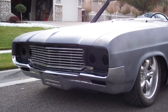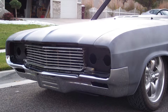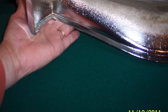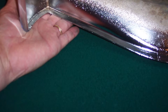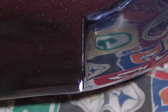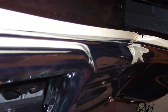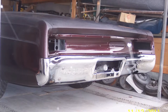That ended up being a really good idea — I'm glad I did — because even though I put notes all over them that these are custom shapes and please don't take them back to stock shape, they did. So I ended up doing a lot of work around the back bumper and front fenders trying to get the shapes back the way they were. The back bumper took a big heavy dead-blow mallet, a rubber mallet, blocks of wood, a lot of tape, and I was able to get the back bumper reshaped without any damage or cracks in the chrome.